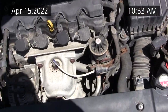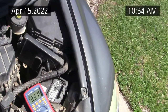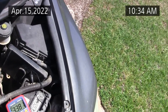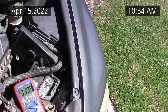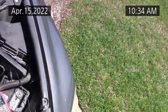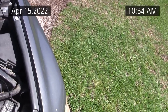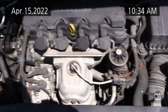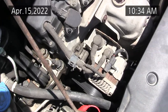And this compressor is not supposed to run 100% of the time. So that clutch relay, compressor clutch, that is computer controlled, it cycles quite a bit and wears out and breaks. So there's a couple other fan switches in here that you can swap around. But I put a pound of refrigerant in here, and I mentioned the pressures earlier in the other segment.